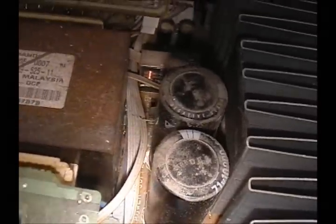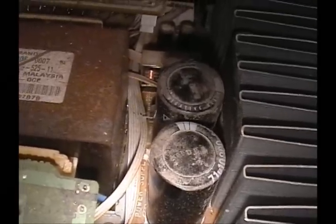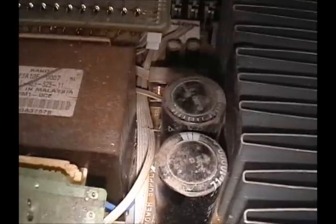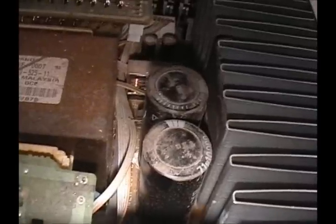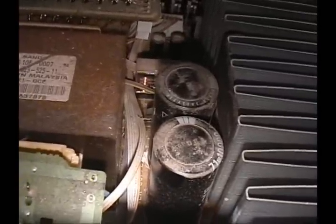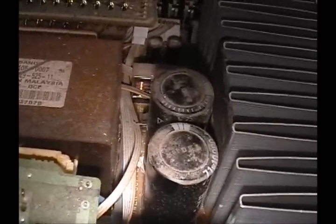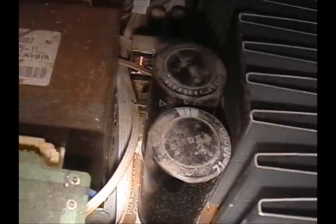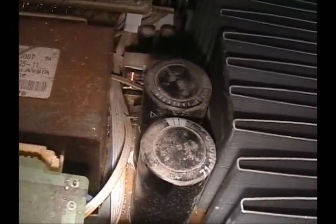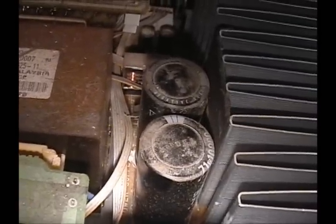These are fairly large. The ones in, let's say, a window unit air conditioner or central air are huge. To discharge them — I've actually seen them melt screwdrivers — because what you do is on the two terminals underneath, you short them out. It's going to spark, so you've got to be careful. You don't want to touch that — it will burn you. It's not necessarily going to kill you, but if you let the charge go through your body you're going to get a jolt. You're probably going to get burnt more than anything — it could put a hole in your finger. I've actually seen it melt the tip off of a screwdriver.